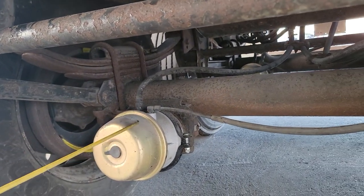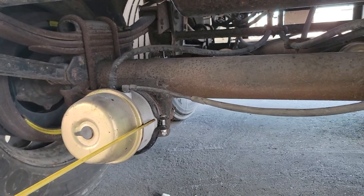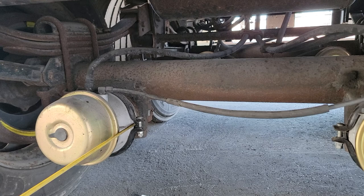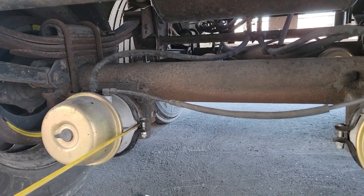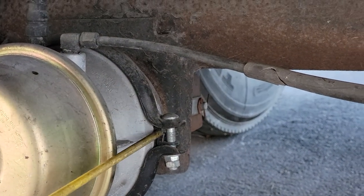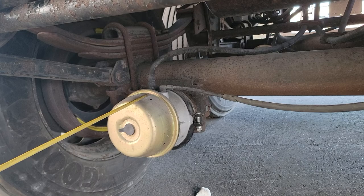They are tied secure to your double brake chamber. Your brake chamber is double in the back, single in the front — keep that in mind. Your brake chamber has a clamp; that clamp is tied secure and not missing any bolts. Inside the brake chamber, you have a seal. That seal cannot be broken, torn, or loose — good condition. Your brake chamber should not have any illegal hoses or weldings, and no leaks, most importantly.